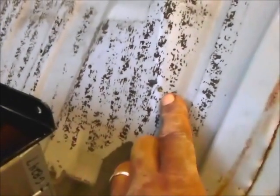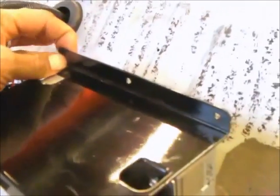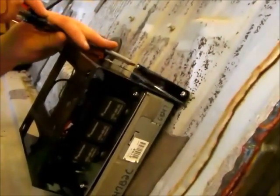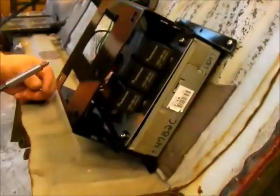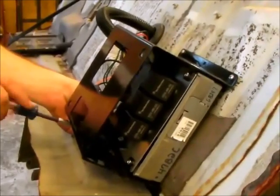Hold the bracket where you want it, mark the holes with a sharpie, then transfer those holes to the body and drill them with an eighth-inch bit. Three screws is plenty to hold it — if you want to make it crash-proof, six will do. Two on the top and one on the bottom is totally fine, though that one may need the aluminum standoff with the longer sheet metal screw. Nate's going to put the last screw in on the bottom, using three total — just the center hole — and that's it.